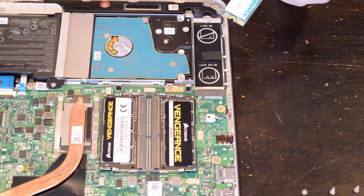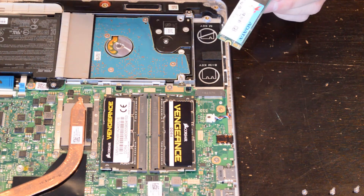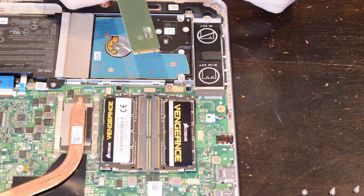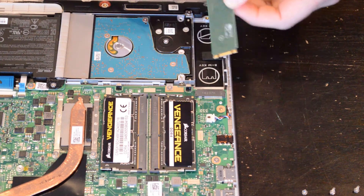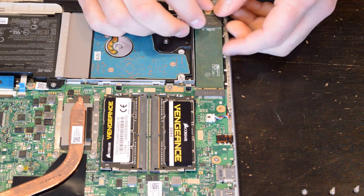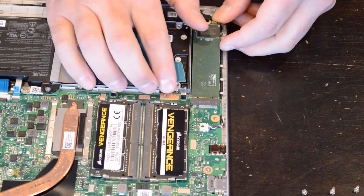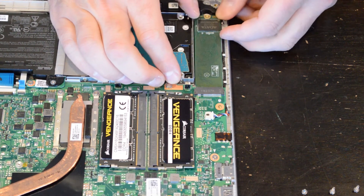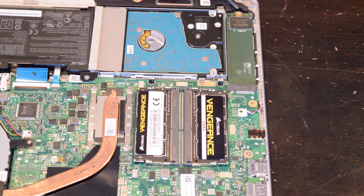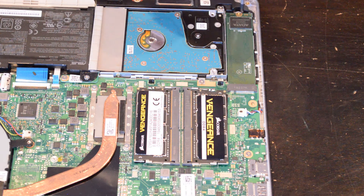Now the M.2 hard drive — this is 512 gigabytes of additional storage, a little more than half of the traditional hard drive, but much, much faster because it is a solid state drive. When you're installing this, make sure it goes in the right direction — there is an up and a down, and if you look at the teeth it'll show you which way you're going. In this laptop it's going in right behind the traditional hard drive. Give it a little pressure and she pops in. At the very top of the M.2 drive there is a hole for a tiny little screw. Unfortunately I don't have one, but if you can find a screw that fits, you probably want to secure this down.